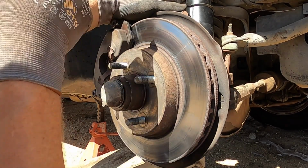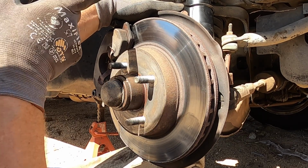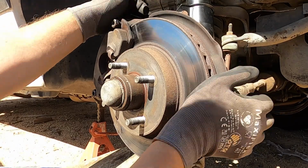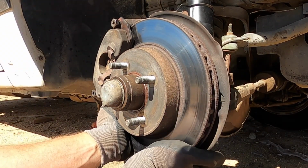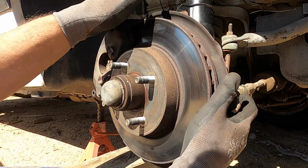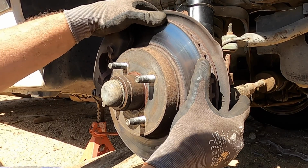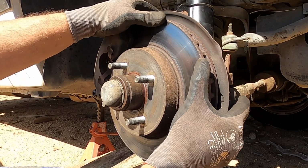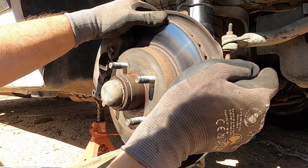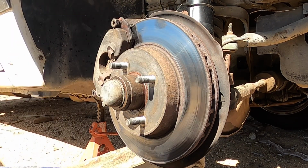Now, it is absolutely interesting that those bushings were all installed wrong, and as a result, this thing rattled up here. You'd hear clunk, clunk, clunk from time to time. The rest of the suspension parts feel pretty good. The lower ball joint I'd use a replacing too, but this rack is definitely, if there's some sort of adjustment in there, but that's too much lash. That's way too much lash for this rack. So I'd say we're arguably in the market for a new rack if we can't figure out how to adjust it. But I think that's for another day. We got the other side to do, and then close up.